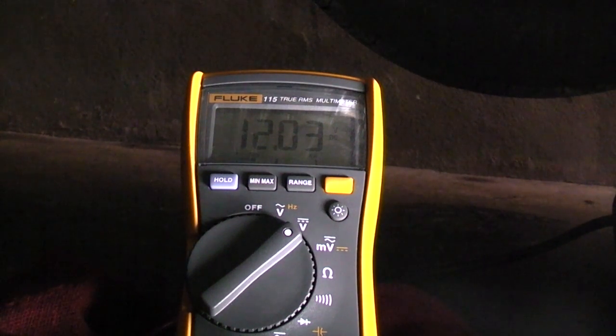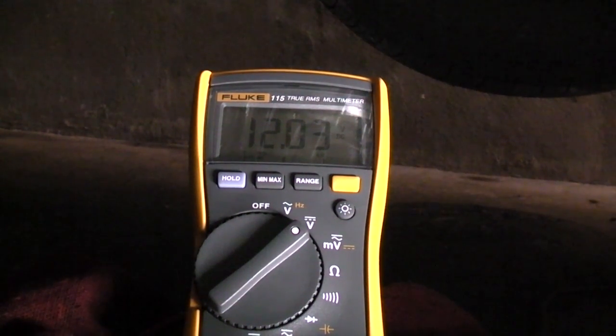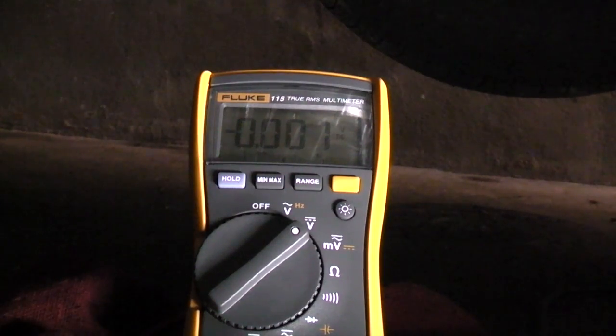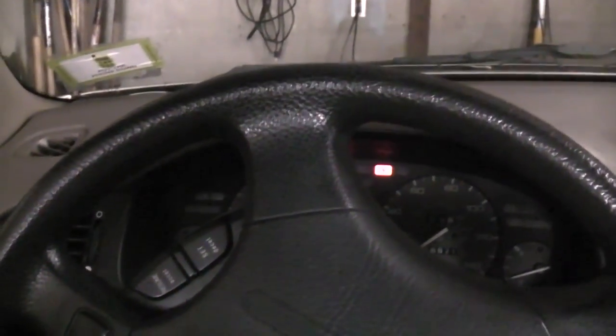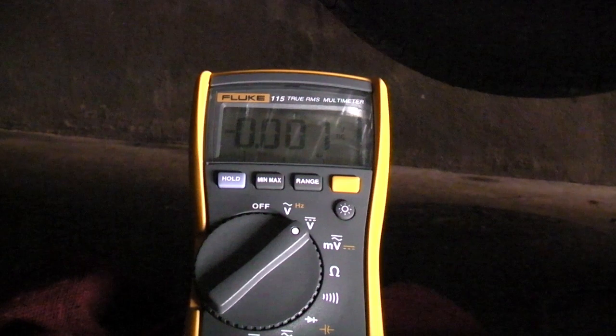Now I'm going to show you a quick way to test the switch. I'm going to reconnect the pressure switch connector and you'll see that voltage drop back down. Now, with your lead still on that green wire, I'm going to start the vehicle up, turn the steering wheel, and hold it at full lock. When I do, that switch should open and you should see battery voltage on the meter — all the way to the right and holding. It'll be around 14 volts when the vehicle's running because the alternator is charging the battery. If you listen closely, you can hear the power steering pump whine and the engine RPM drop when the wheel's at full lock.